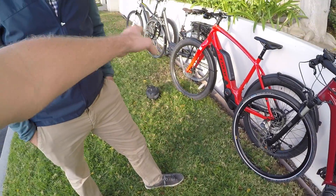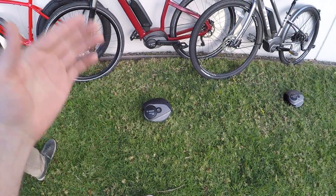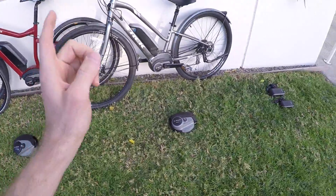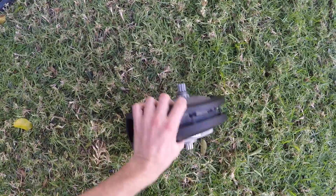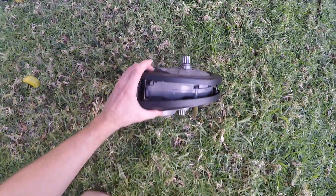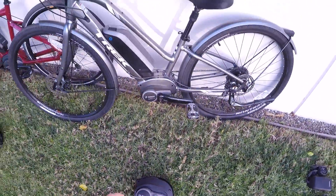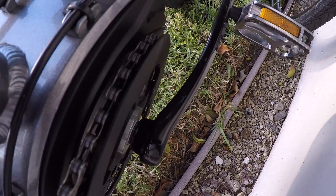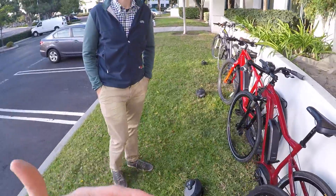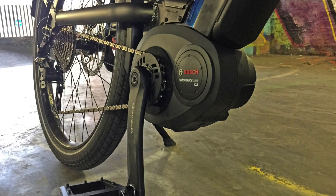It's neat to see just how much smaller the redesigned motors are. Whereas all the Performance Line motors weigh about 8.8 pounds, the Active Line Plus is 7.1 pounds, and the standard Active Line is just 6.3 pounds — quite a bit smaller in profile. Looking at the chain ring used on these, it's a more traditionally sized chain ring that spins at roughly a one-to-one ratio, whereas the Performance Line motors had reduction gearing at about 2.5 revolutions for every single crank revolution.